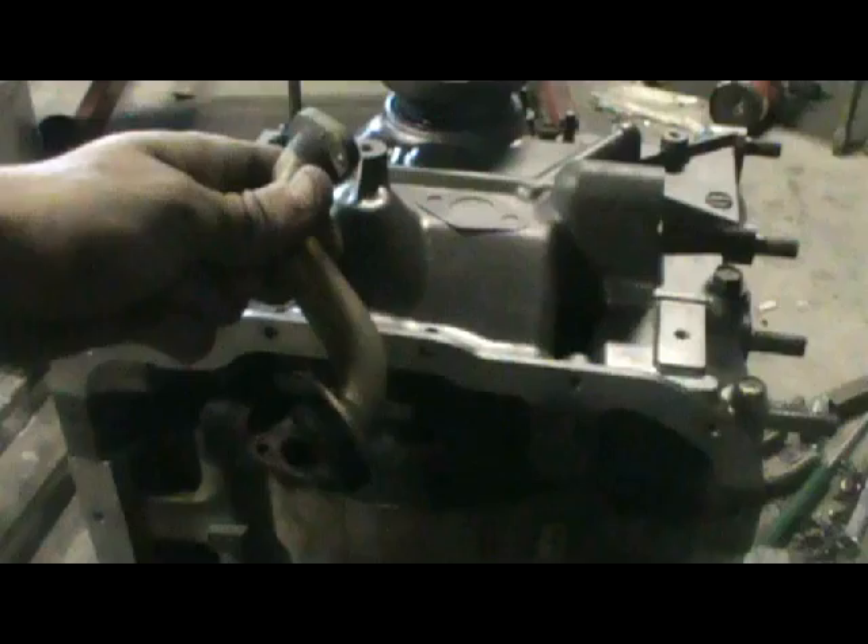Before I forget, I've got to clean this up a little bit and then put on the new oil strainer. I got my oil strainer right there and a new gasket. I'm just going to put a really thin coat of silicone around there and then I got the two bolts, so I can toss this on and put the oil pan on after.